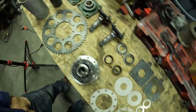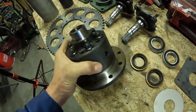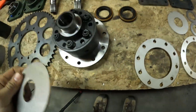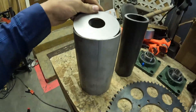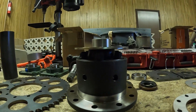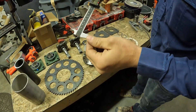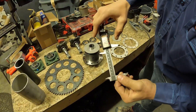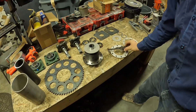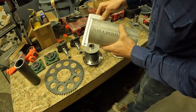I'll have links to where you can buy all this stuff in the description. First we're going to start by building the oil can for this differential. I'm going to cut off a section of this pipe. To get the measurement, set this plate right on there and measure the distance between this. I'm getting about 3.6 inches. I might cut it a little bit short because I can just fill it up with weld — I just don't want it to be too long. So I'm going to square this and make sure it's within spec.